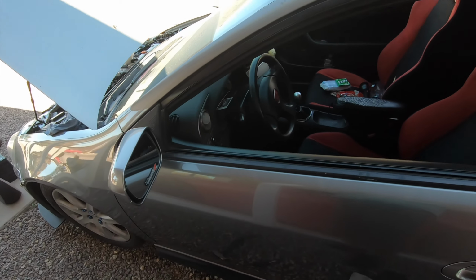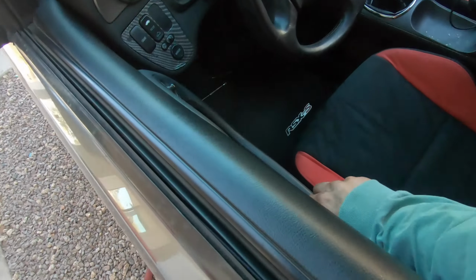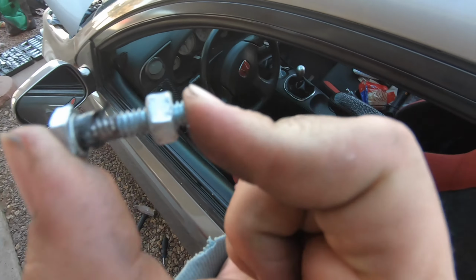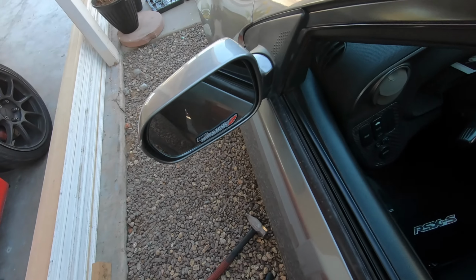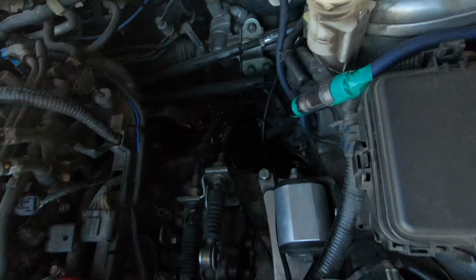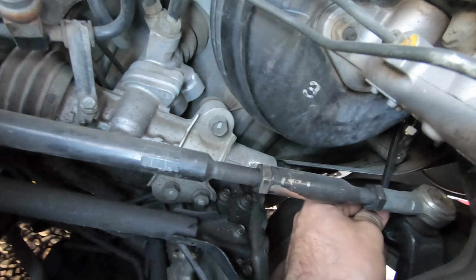All right, quick update. I got the clutch master cylinder loosened from this side, and loosened these bolts here too. This is actually running through the fork and acting as a fastener instead of the little metal pin that they have. As you can see, I disconnected the line already, and this should slide right out. There it is.